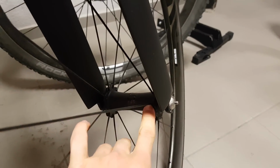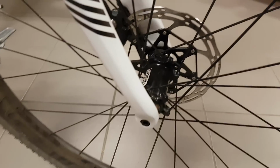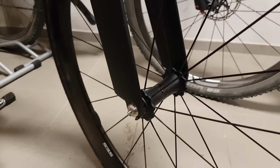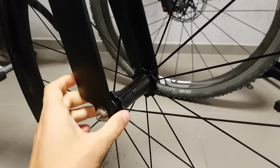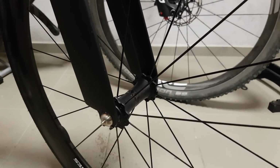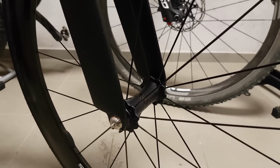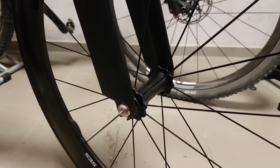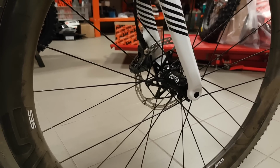I don't know about the stiffness numbers, but the carbon TIs do use straight pull spokes if you want, although I think there are flanged options as well, but I prefer the straight pull versions. Really, they're just a more modern look. Yeah, they have bearing preload adjustment, which can come in handy, so then they don't have the preload preset as with DT240 style hubs like these ones. They have a pretty damn good and very easily serviceable ratchet mechanism, and also the bearings are quite sturdy, and yeah, the seals as well. I have these in off-road applications, as you can see, quite a lot of washing on there and no problems so far.